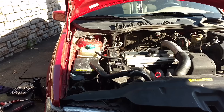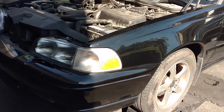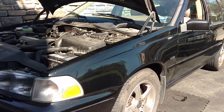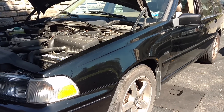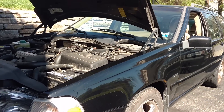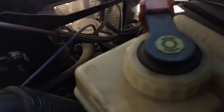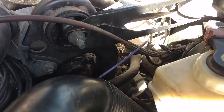I'm going to go get that R. Check that heater core in it — if it's fine, I'm going to pack it up and hit the road. I have this R here. I need to replace the top O2 sensor. It looks like somebody has replaced some of the exhaust, probably put an aftermarket cat on there. Looks like they also may have changed the rear O2 sensor, and in doing that they probably put a wrong sensor in the rear. Gas mileage is horrible. I'd probably rather replace the exhaust from the turbo back to behind the cat with a Volvo one, then replace this sensor. The sensor is right under the turbo — near impossible to replace. I think I'm going to give it a try from up here, take this air box tube out, see if I can reach it.